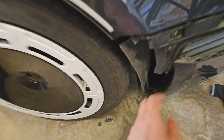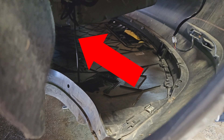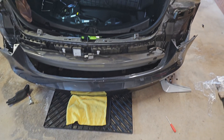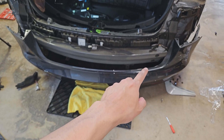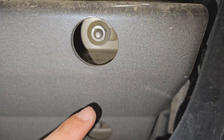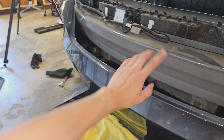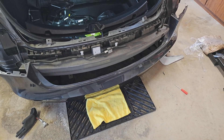On this side I actually haven't checked yet — you can see right there, that's the wire, also almost at its maximum. Now if you don't have underglow, you can just pull this whole bumper off — there's no need to leave it hanging. For me I have underglow, so I have to be a little bit careful. What I'll do is unbolt this side — there are bolts right here, I think there's only two — and shimmy the bumper so that I have enough space to work.